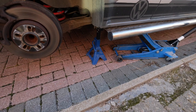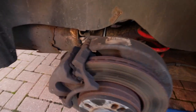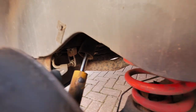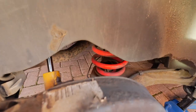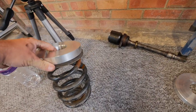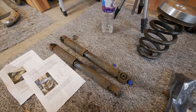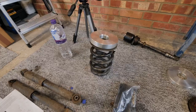Front's done, all back together. I've got the rear end jacked up with the rear wheel off — axle stand and trolley jack under there just in case. The rear should be a bit easier: you've got the damper with a bolt at the bottom, and up inside there's a bolt at the top. Undo that damper, push it down and get the spring out. The stock ones sit up to the body, and the spacer with the chamfer edge goes to the top — we need to squish the spring back in then push the arm up to bolt the standard dampers on.